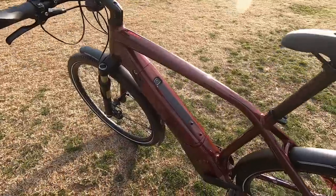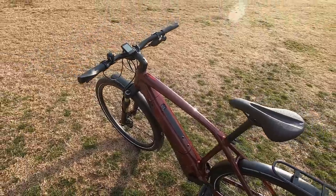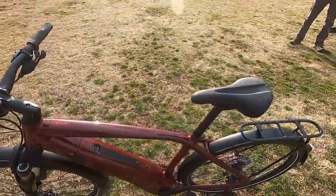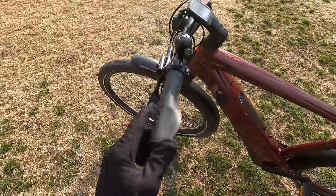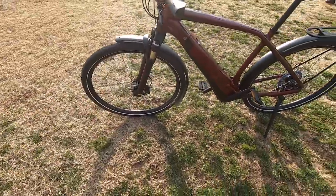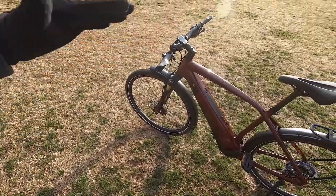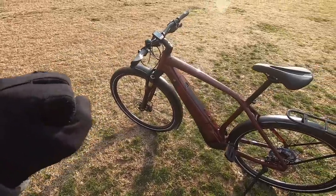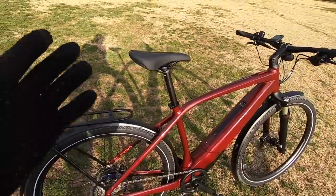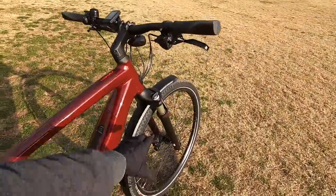The size large is perfect for someone who wants that efficient, rigid, high-performance design. They do have some comfort-oriented touch points: the saddle feels very good, with lightly ergonomic locking grips — body geometry, that Specialized thing. The tires are rated 50 to 75 PSI. The seatpost is 30.9 millimeters — it's a rigid post, but you could get a suspension post if you wanted, called Connect, formerly Body Float. Then there's the suspension fork. The wheels are attached with a 15mm through axle up front with a 5mm hex bolt pattern, and a 12mm through axle in the rear with 148mm hub spacing — like boost.